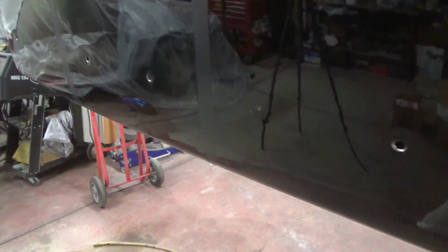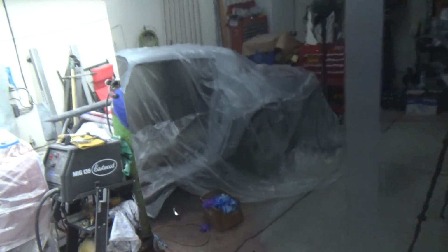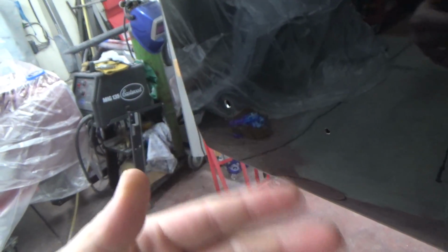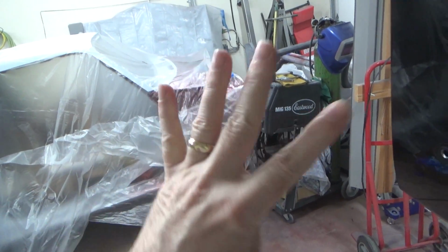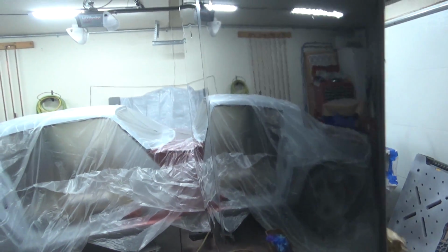All right. So yeah, the experiment worked. This definitely moved more than it should have. I said I didn't see that sag in it last night, and it's not too dramatic, but this is 3 coats of clear. Since I'm doing candy type stuff, I need at least 4, so it would have been even worse than this had I done 1 more coat. The 1% didn't seem to have made a huge difference, slightly, but the 2% really worked well. I don't see any difference in terms of sheen or anything. We did not end up with any dry spray in the middle here.